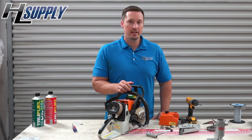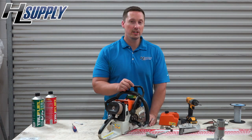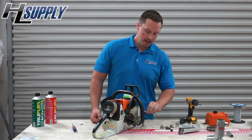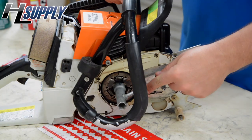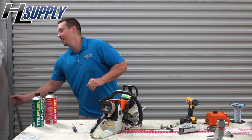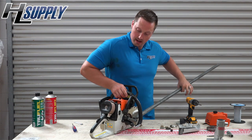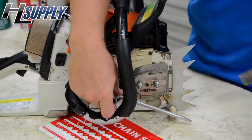Now that the piston has been stopped, sometimes clutches are very hard to remove. So we have a trick to show you so you can learn how to do it easily at home. Using basic tools, if you don't have impact wrenches or something special, you will get your wrench on and then remove it using leverage — a handy piece of pipe.